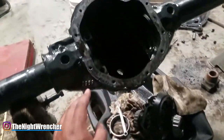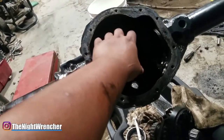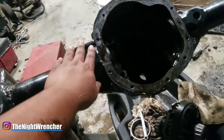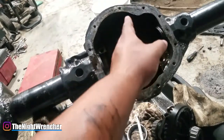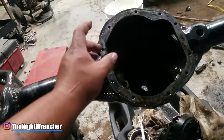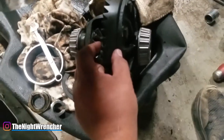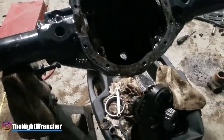For the Dana 44s, if you're switching carriers — your original axle carrier number was 3.73 or lower — when you install a new gear set of 4.10 and higher, you're going to need to get what they call thick gears. So we've got standard gears like I bought, and then we've got a set of thick gears that are significantly thicker.